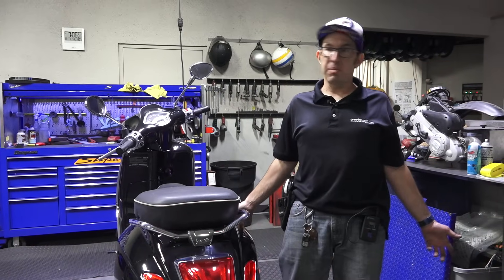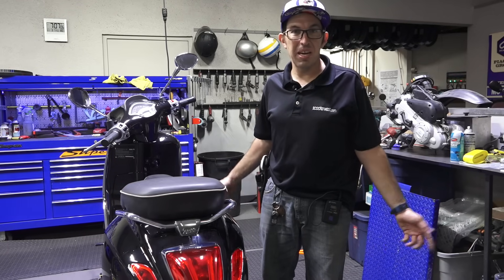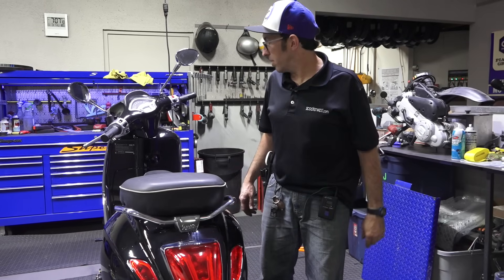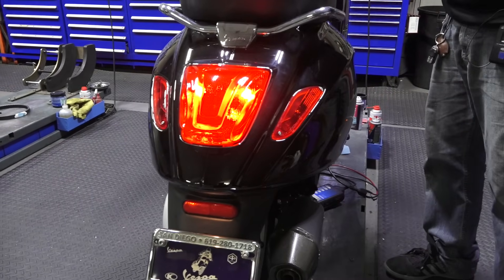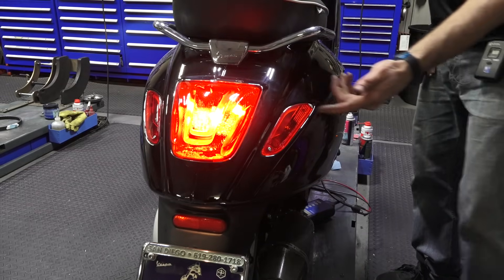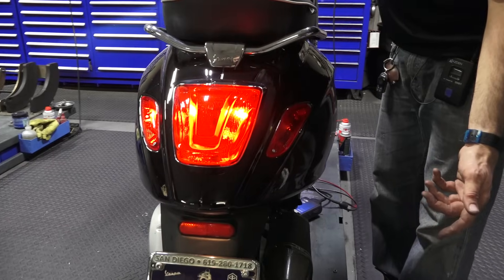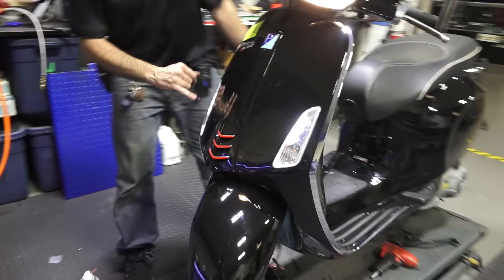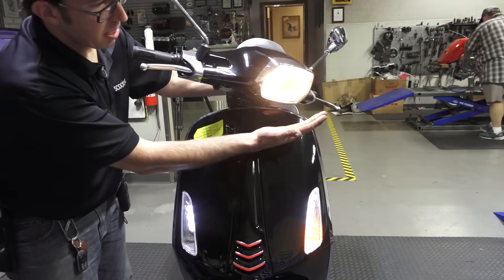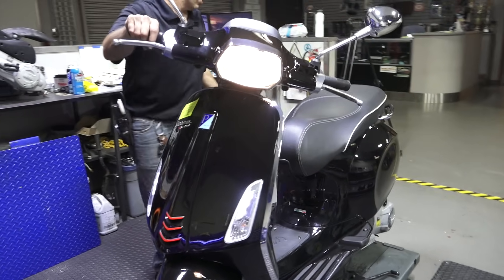Number three, you want to check your lights. You might think it's pretty obvious — you know the headlight's working if you're riding at night. But a lot of times people don't notice their tail light's out, and riding down the highway at night with no tail light is probably not the safest idea. Keep in mind this scooter's got the Euro kit so it does not have the pod-style turn signals. Check both brake switches, your turn signals front and rear, your running lights, your high beam and low beam, your horn, and the last light a lot of people ignore is your license plate light — that one's lighting up just fine.